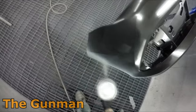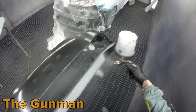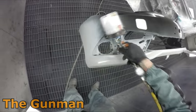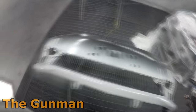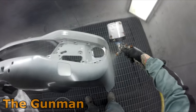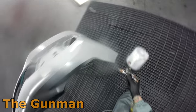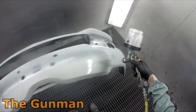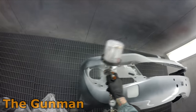I asked another painter why they don't use that additive, and he said basically it makes it go a little bit gooey and jelly-like. On this bumper bar I did have a few spots I had to scuff back, and if I'd put that additive in it may have made it trickier to sand back. So I'm happy to do it this way — it's really not a big deal to put a coat of plastic primer on first.